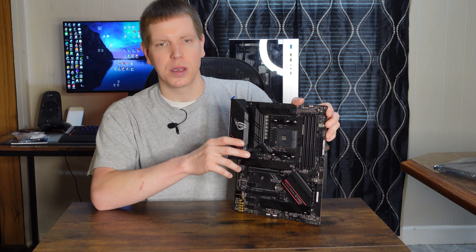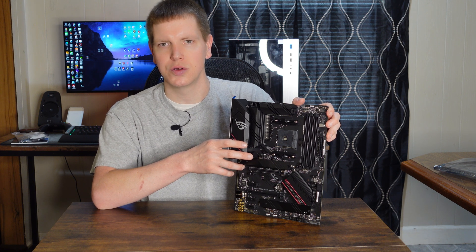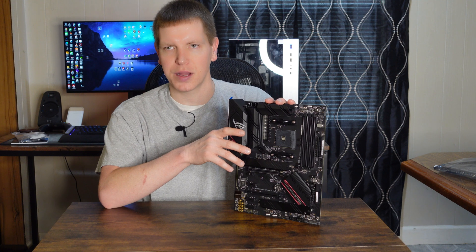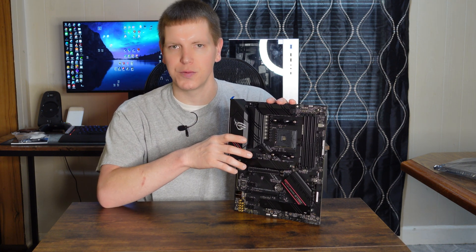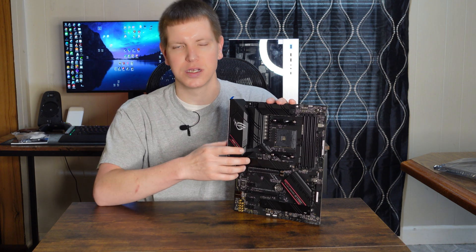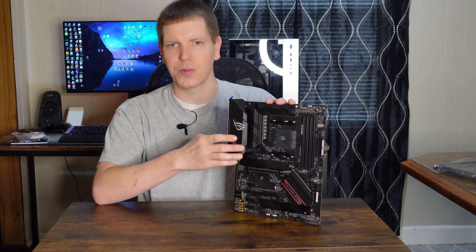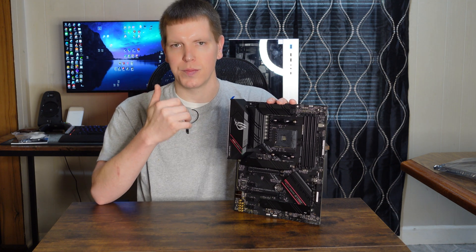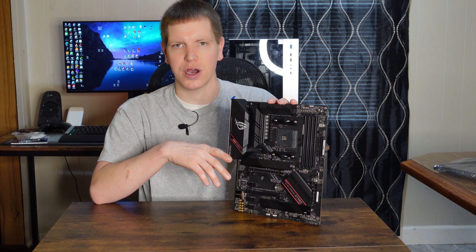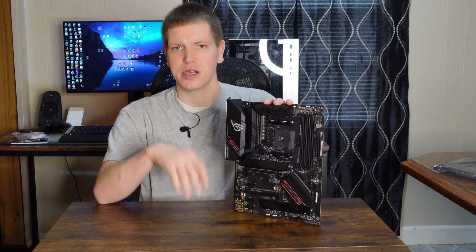As far as connectivity on this motherboard, we are in pretty good shape. This right here is our x16 slot — these 16 lanes are coming directly from your CPU. This motherboard does not support SLI. Of course there are some high-end B550 motherboards that do support SLI, but basically nobody uses that anymore. The 16 lanes come directly from your CPU. Down here this is a PCIe 16 slot, but it's only 3.0 because everything coming from the chipset is 3.0 — that's one of the biggest differences between B550 and X570. So the two things that are PCIe 4.0 are your 16 lanes going directly to your GPU and your four lanes going directly to your M.2 slot — both coming directly from the CPU. The bottom M.2 and all of these other PCIe slots conform to the PCIe 3.0 standard. Your bottom M.2 slot is PCIe 3.0 x4, and this other slot is PCIe 3.0 x4 — it's a x16 slot but only wired for x4 electrically.